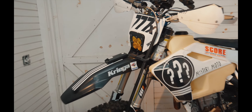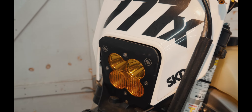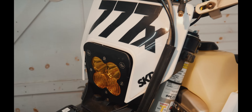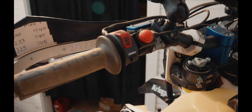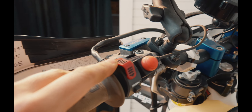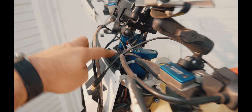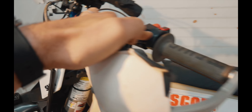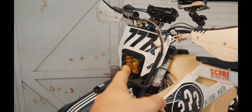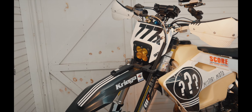We'll start at the front and make our way back. Arguably one of the most important things is a good headlight. We're running a Baja Designs XL80 Pro with the amber lens, spot and flood combo — really, really bright light. There's a switch up here on the handlebars that allows us to switch between high, low, and off. This switch is made by Sick Ass Designs, and there's also a wiring harness that allows that to work with the switch. We've also got a black fender to try to absorb some of that light coming off the Baja Designs light — with a white fender it reflects back up to you and makes it difficult to focus.